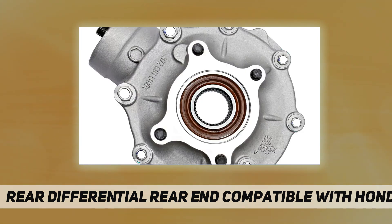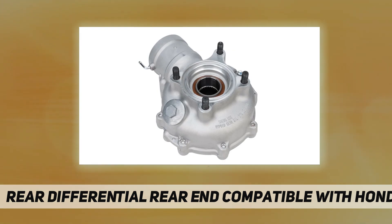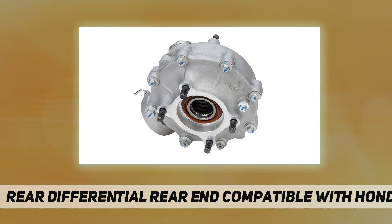Causes of damage include: one, not driving adequately in the break-in period; two, not changing the differential fluid between 20,000 to 40,000 miles; three, allowing wheel spin; four, not checking the breather fitting and breather tube regularly; five, not upgrading the differential cover.